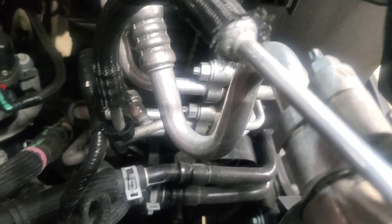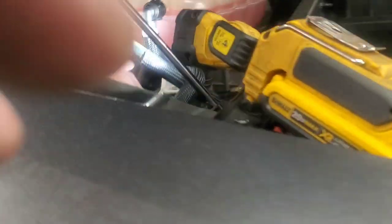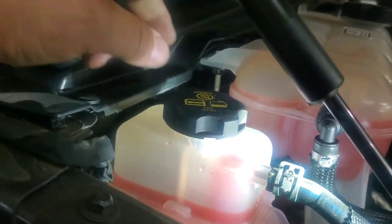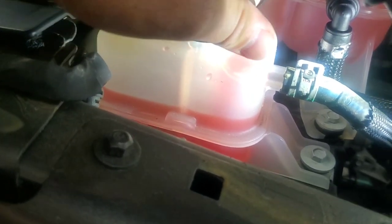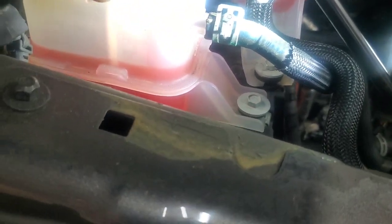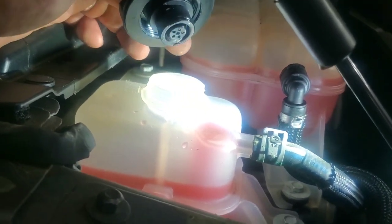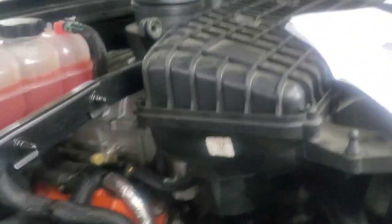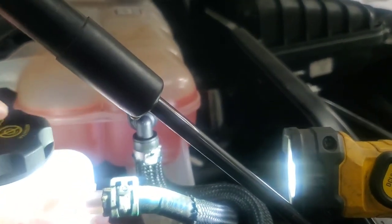The rest of the business is right in this area — pretty much the coolant hoses. So now we're moving on to the coolant part. This won't just spin off — there is a slot. You need to line up: just take a zip tie, stick it in that slot, and then unscrew. I got the zip tie back out and this just comes off.